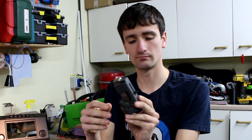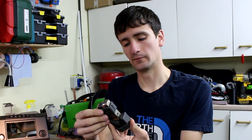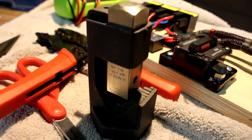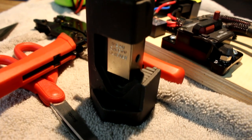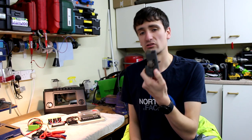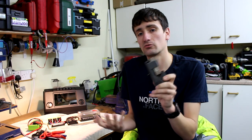For example, I have this little battery lug crimp tool for the thicker gauge wiring. All it is is a spring-loaded punch and die which you hit with a hammer, and it crimps a battery terminal lug or winch wiring — something along those lines. Without this it would be very difficult to achieve a good crimp. This was relatively cheap — things like 20 to 30 quid.